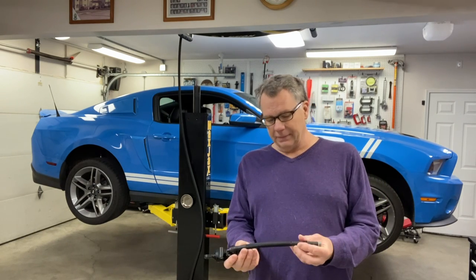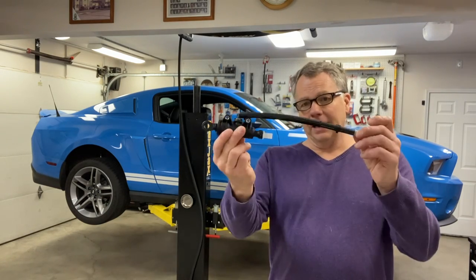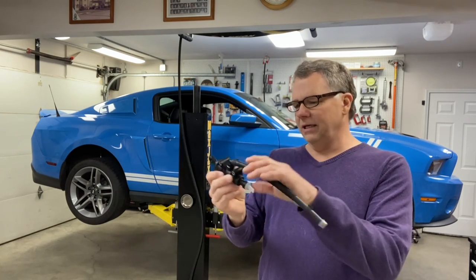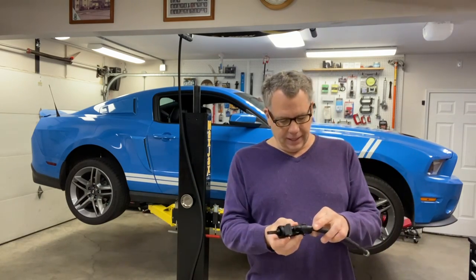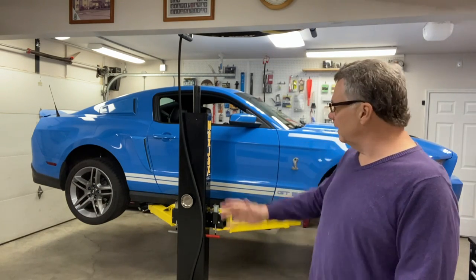There was some air in the lines that we got out, but still it does not fully disengage. I'll also give you an example of what it's doing in a minute. But anyway, I got a new master cylinder, so I'm gonna go ahead and install this. With the existing one, if you let it sit for a day or so, you get in the morning, push down the clutch, it almost goes to the floor with no resistance. So there's some kind of leak on the master cylinder. The slave cylinder is brand new on this thing, so I'm really thinking it has to be with that, or perhaps even a line. But anyway, we'll check into that. So with that being said, let's go ahead and get started.